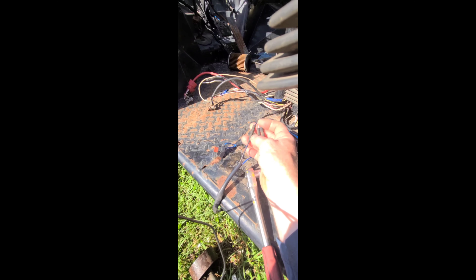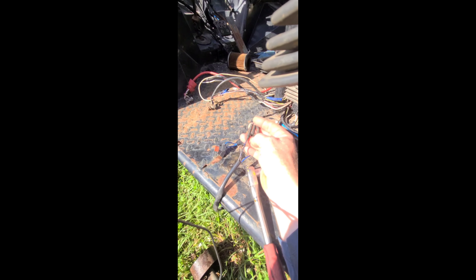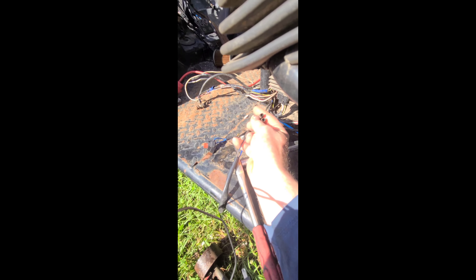This dark blue/black wire should be the one that goes back to the fuel pump. It never did fire up when the key was on, and again these relays do get hot when the key's turned on.